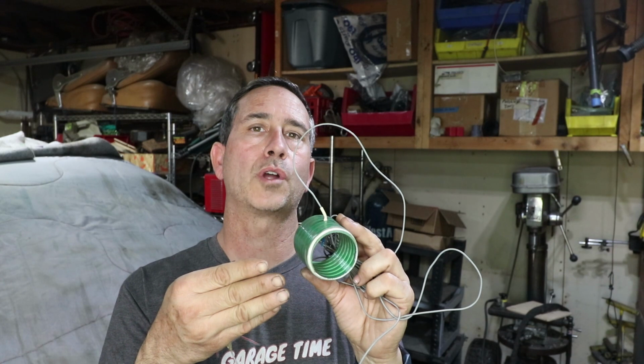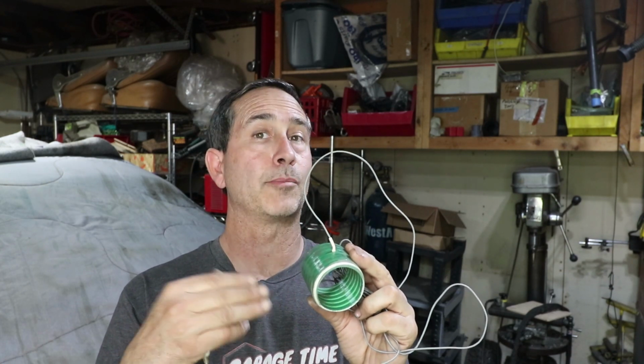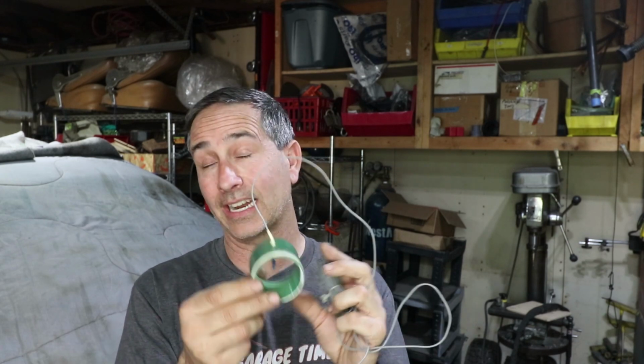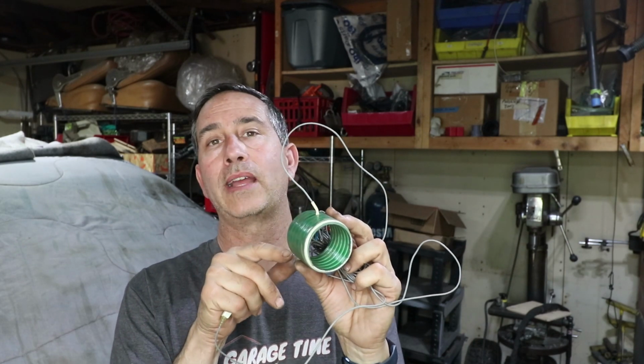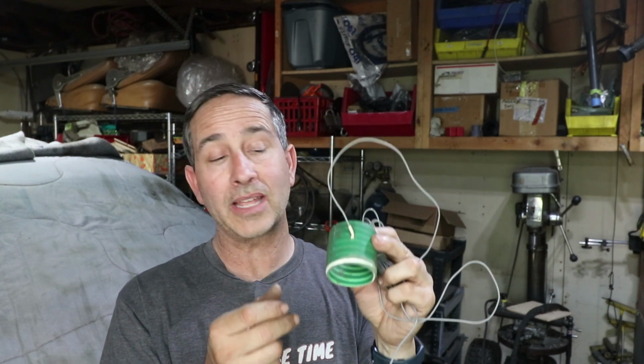The more air that flows over that hot wire, the more it's going to tend to cool it. So they have to put more current into the wire to maintain a constant temperature. This is a good way to measure airflow or mass flow. And I'm going to be using this. It's probably a little bit more accurate than the synchrometer.